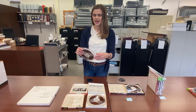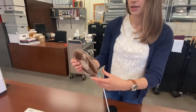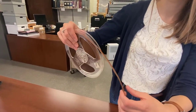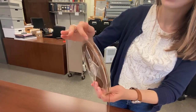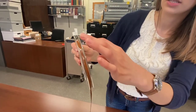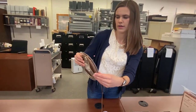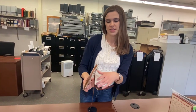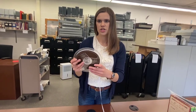In this tape, we can see another sign of damage caused by vinegar syndrome, which is called warpage. When I undo the leader, you can see that the tape itself is quite brittle, and has what we can perceive as kinks in it — the tape actually being warped. It has the consistency of almost like a ruler; it's very hard. We see a lot of issues with tapes that display warpage when we go to record them, because the tape sometimes will actually bend as it's trying to be recorded, and then there are lots of issues during playback.